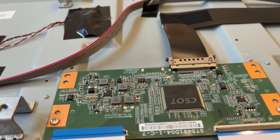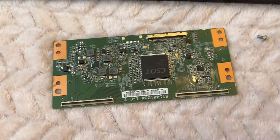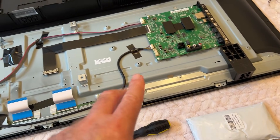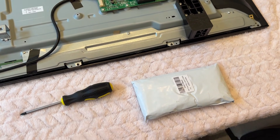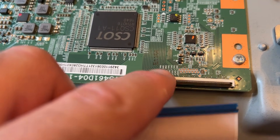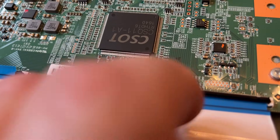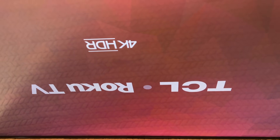And look at that — we now have half of our screen responding. So the easiest, cheapest fix is going to be simply getting a new T-Con board, because they're only like $25 to $30. Got the old board out — it's just two screws. New part just came in, two days, $15 from Amazon. I'll put a link down below in case you need this particular one for this model. But even if you have a different model, just Google or put in the Amazon search the model number and the word T-Con — T-C-O-N — and it'll pop up whatever part you need. New one screwed down. Now to put these back in, just make sure these little tabs are flipped in the up position, align the cable in there, and flip it down. $15 — I'll clean it up, get all the dust out, screw that back panel back on, and I'll have a like-new TV.